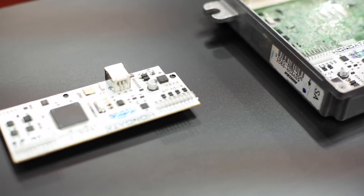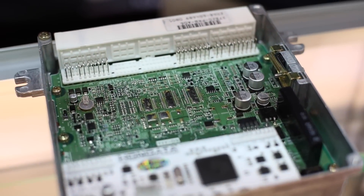We've added a lot to the K-Pro 4. We have digital inputs now, we have digital outputs, we have access to CAN bus. To make it sound a little bit easier, what this enables you to do is now hook aftermarket dashboards into your K-Pro, so you've got a great choice of different dashboards you can connect to.